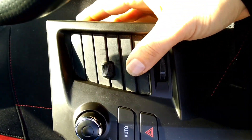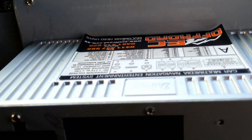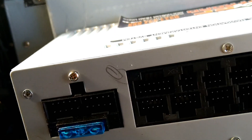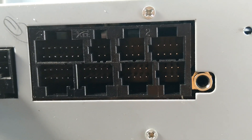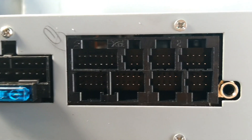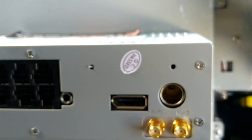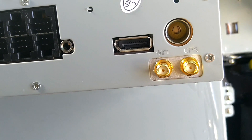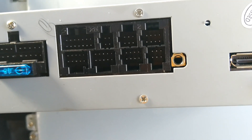Good time to check — make sure everything is still working, everything lines up, everything's moving correctly. Now at the back of the head unit we're going to plug all the cables in. These plugs are all different shapes — do not try to push or jam the wrong plugs in the wrong spot. If it doesn't want to go in, don't put it in. You have your GPS and Wi-Fi antennas to connect, your main antenna, your HDMI cable, and next to that is for the external mic.